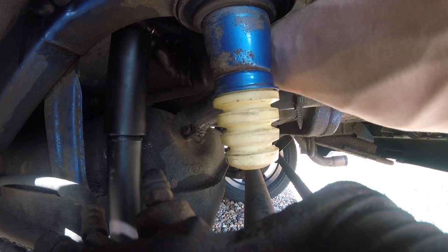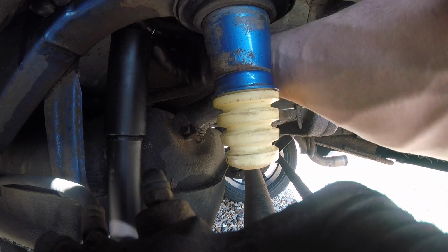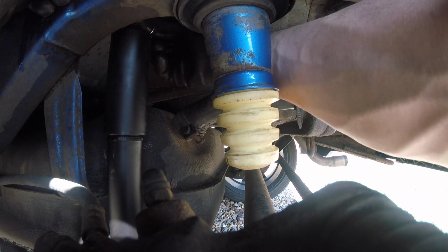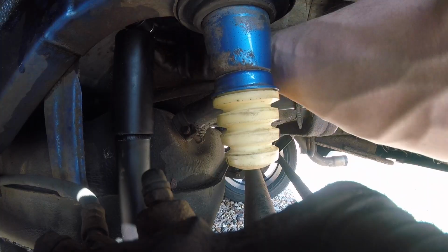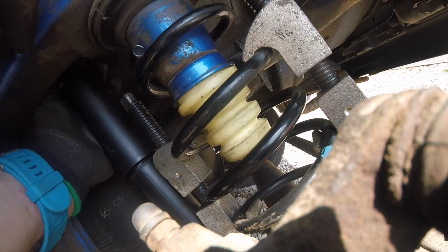Itself, and buying new nuts and bolts for this job. The top ones are extremely long. The one on the other side was very seized. They make them very long, so in assembly they can hang the axle onto their car easily. The bolts have a self-tapping action or a slot to help clear the hole.